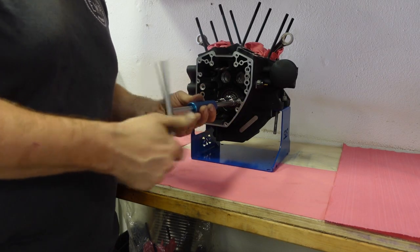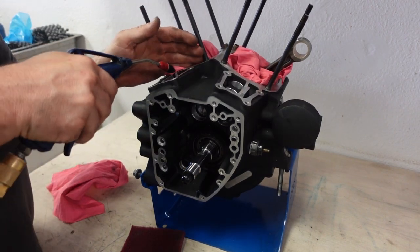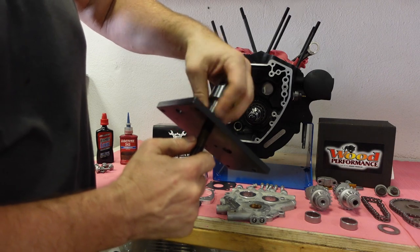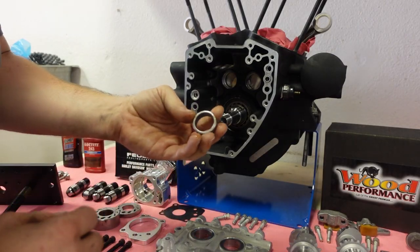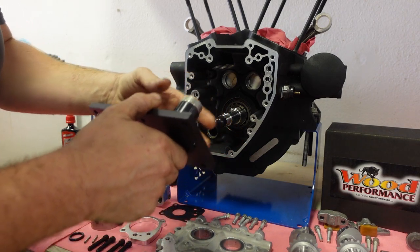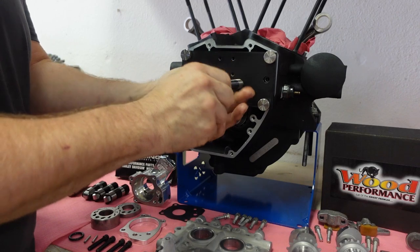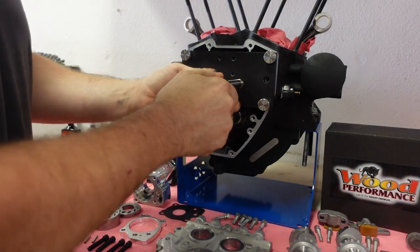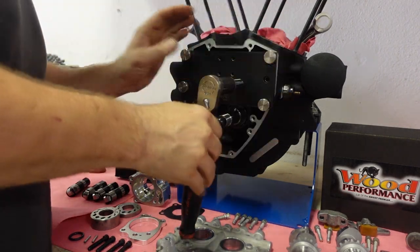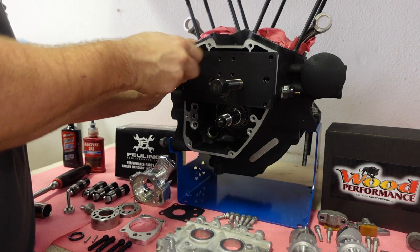It's always a good idea to chase all the threaded bolt holes in the engine case and clean them out so our torque specs are going to be proper. Now we've got to install the inner cam bearings — Jim's makes a good tool for this. It's got a plate, a threaded rod, and an adapter for the bearing. The bearing gets pressed in; it has writing on the face — that's the side you press on. That race is actually a little bit thicker so it can support the pressure of pressing it in. Hand-thread the knobs on to hold the plate in place, double-check the bearing is sitting flush, then tighten it down until it stops. The Jim's tool has a stop on it so it stops at the right depth. Then remove the tool and do the same thing on the left bearing.